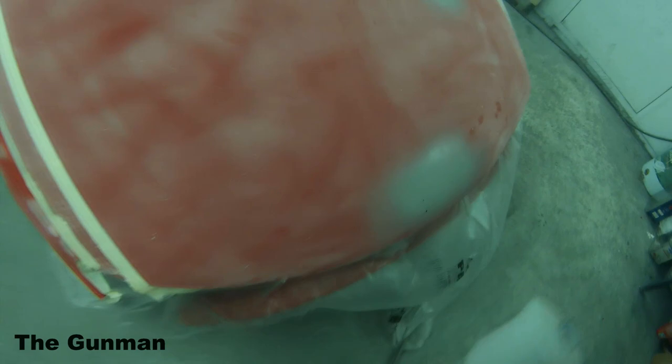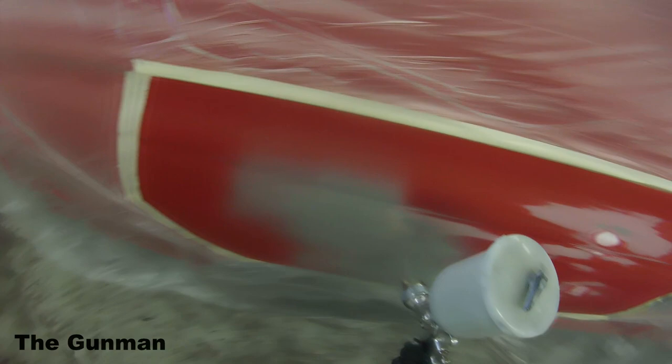Basically, where you've cut through with your sanding papers — through your clear coat, through your base coat, into the primer — if you put that first coat on too heavy, you can end up seeing a bit of an edge around those repairs. Sometimes after it's been painted, you might get it out in the sun a couple of days later while it's still curing and end up seeing a bit of that edge mapping. But do it this way and you'll find a lot less chance of that happening.